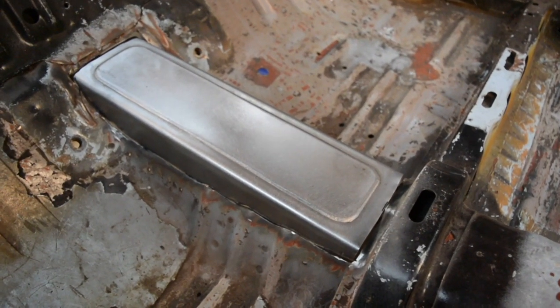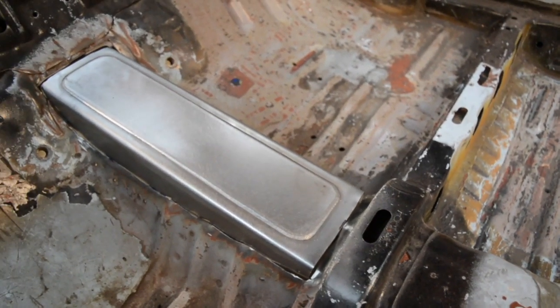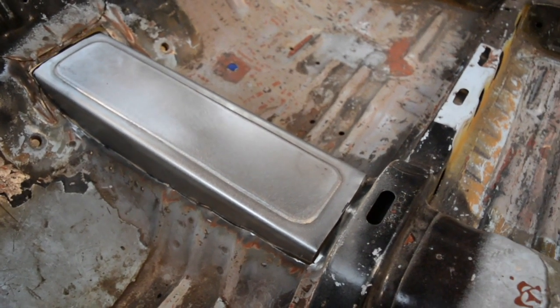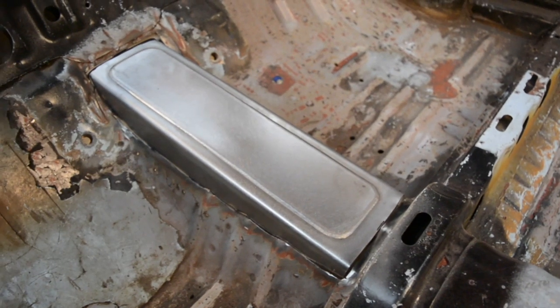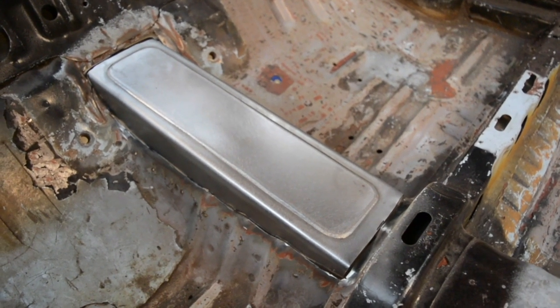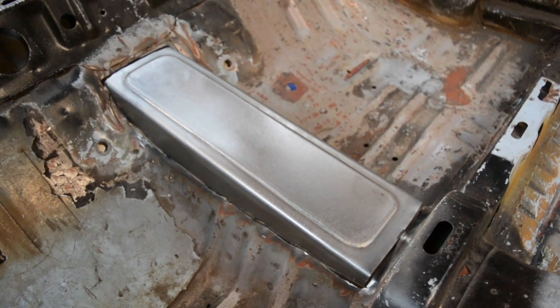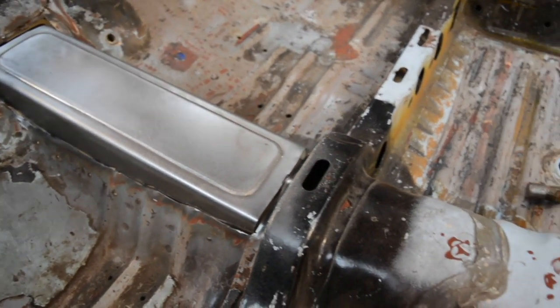I've got a little Lincoln that does real good on this sort of stuff. You might notice when I'm welding on panel steel, I don't really continuous weld, or do a lot of spot welds. It's mainly because I have the welder set a little bit hotter than you normally would, and if I continuously weld, it'll burn through, but I prefer to run it hotter and then do a lot of stop starts rather than having it cold and being able to do a long run.